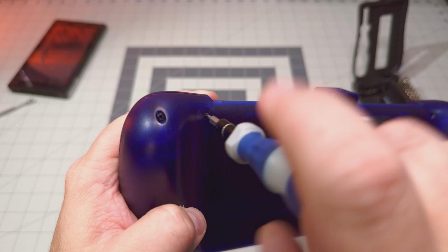Let's go ahead and place this back over top of our controller. Again, when you're placing this, make sure it's getting in there nice and flush. Now we need to reconnect all the ribbon cable. Just got to reverse the process. Just be very careful not to fold or cut your ribbon cables. It should just fit in there nice and snug. Slip it up underneath, and just push it down on there. Tweezers can help. You want to be careful of these little wires so that you don't pull them out. So I'm just going to use the tweezers to push on the sides after we get it lined up.